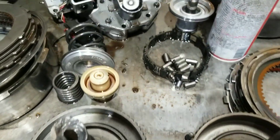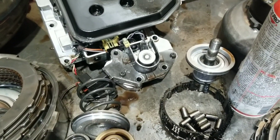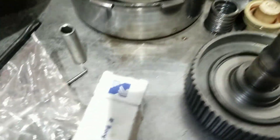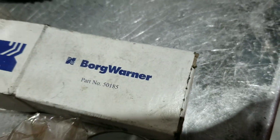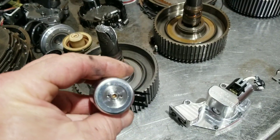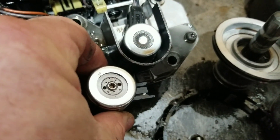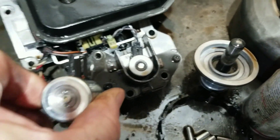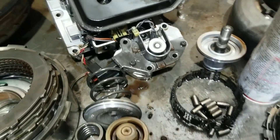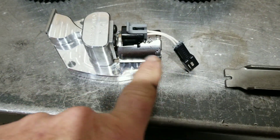They also offer one for the factory that I put in my gas 47s and 46s - it's bigger also. It's Borg Warner, and this is your factory replacement upgrade. Even it's bigger than the original - see the size difference? It's a direct plug-and-play to the factory harness. But because of the GM style solenoid, they have to give you a pigtail to make it work.